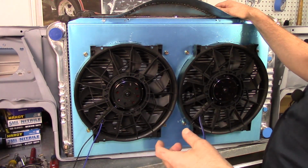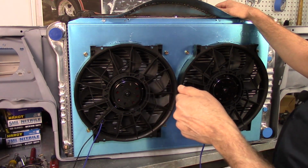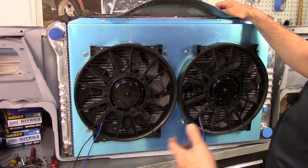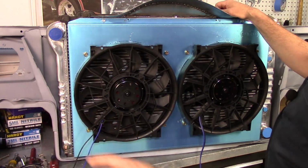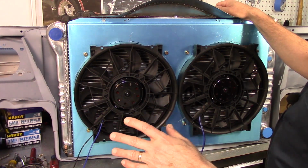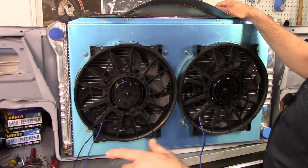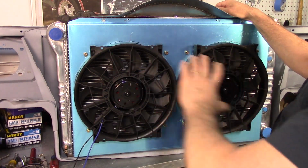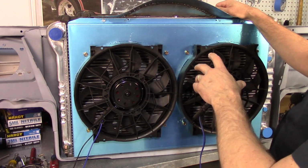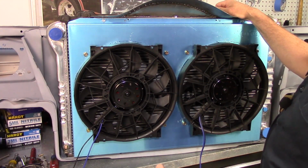A lot of the plastic connectors under there, once they go through so many heat cycles, the plastic starts to get brittle. I'm eliminating all that. I'm replacing all the connectors unless I can't find a replacement. Replacing all the wires from the junction block out to every single thing that it connects to. And I'm going to build the custom harness because I want to hide the harness as much as possible.